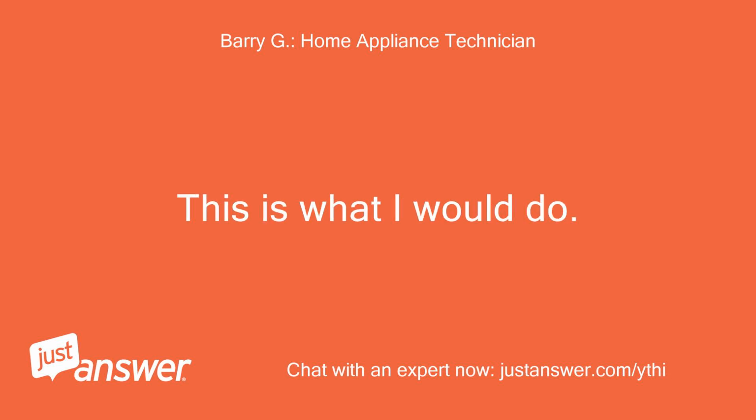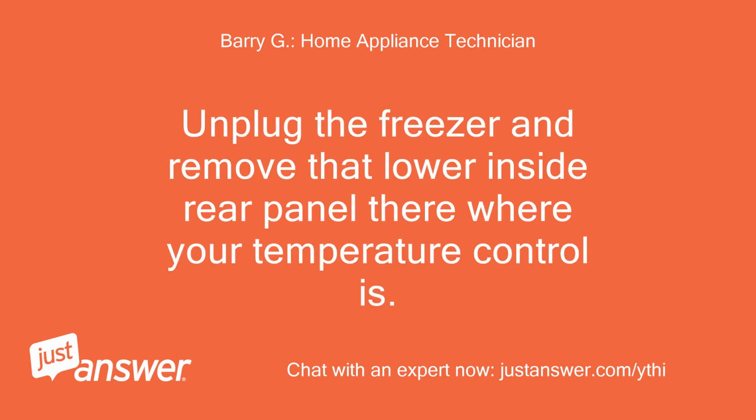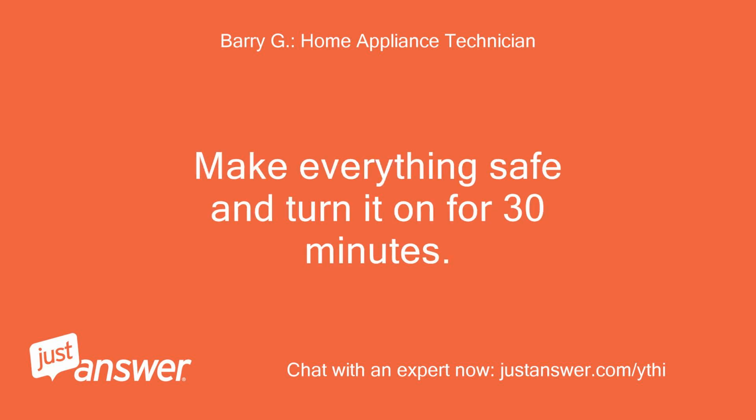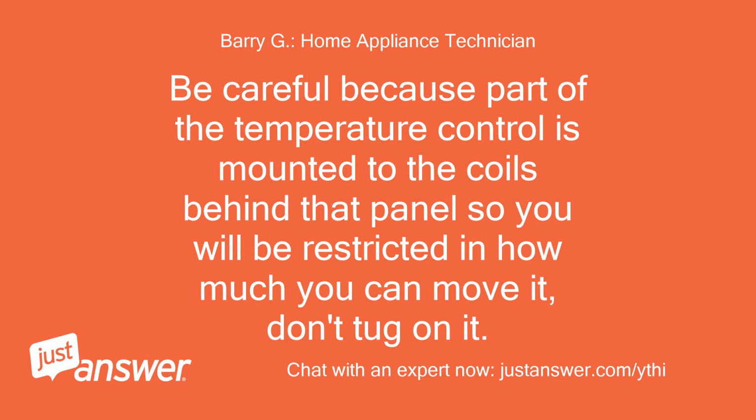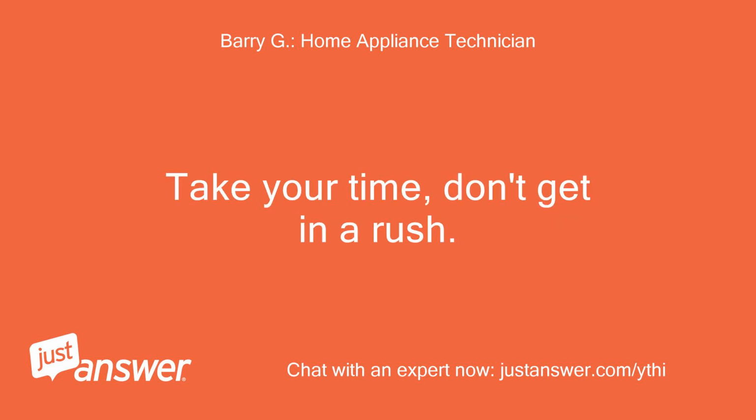This is what I would do. Unplug the freezer and remove that lower inside rear panel there where your temperature control is. Make everything safe and turn it on for 30 minutes. You don't need to take the panel all the way out, just enough to be able to see the coils behind it. Be careful because part of the temperature control is mounted to the coils behind the panel, so you will be restricted in how much you can move it. Don't tug on it. Take your time, don't get in a rush.